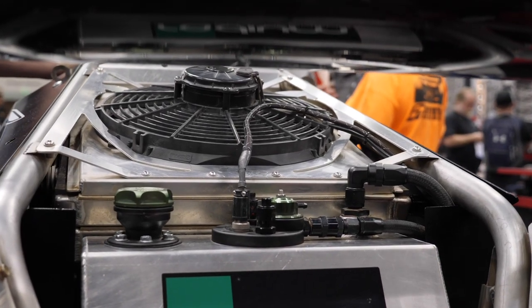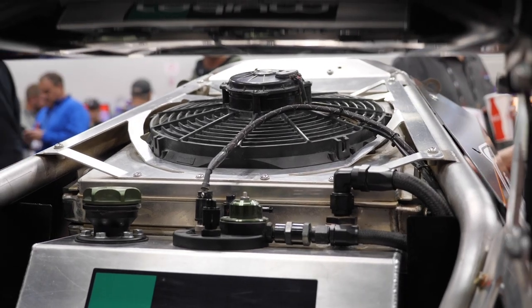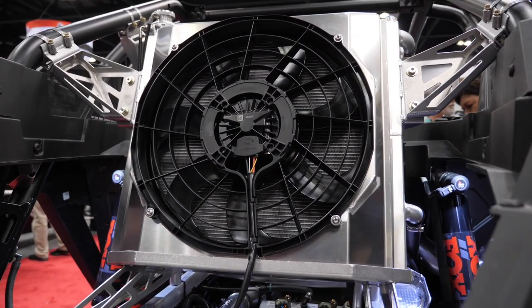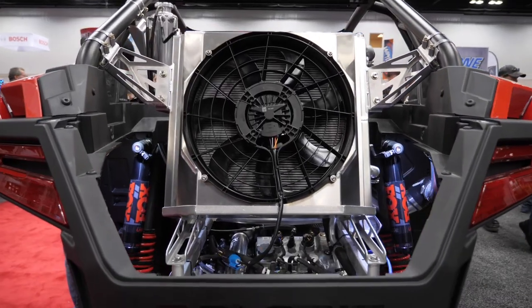Getting the engine coolant under control is only part of the puzzle — oil also takes a lot of heat away from the combustion process. For a factory engine with no oil cooling, a simple remote-mount oil cooler kit running off an oil filter adapter will really help both with engine oil cooling and engine coolant cooling, because the oil has more direct contact with the engine. Sometimes putting an oil cooler on can actually drastically help your water temps as well. For more serious applications, a full-face oil cooler fitted behind the radiator is an option. By moving to a slightly thinner radiator, you can open up the rear of that package to do additional oil or transmission cooling.